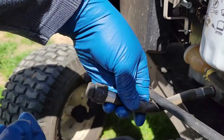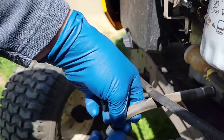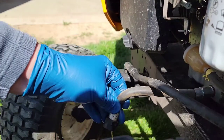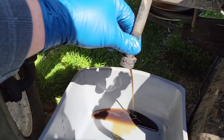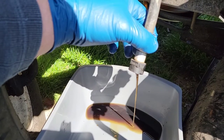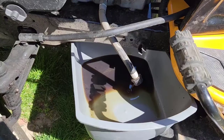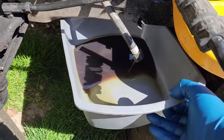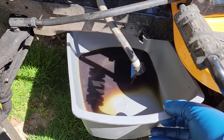I'm going to get some gloves on. You can hold the hose up so the oil doesn't come flushing out right away, but I like to hold it down right into the bucket. And there comes the oil. I probably could have warmed this up a little bit longer — it's not coming out the fastest. The hose wants to lay at an angle, so I wedged an old bedpan underneath the mower to catch it because it takes a while. The hotter you get the oil, the faster it's going to come out.